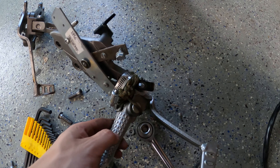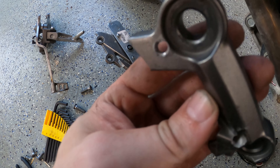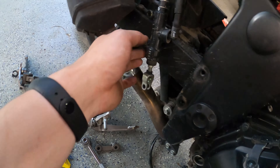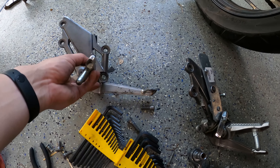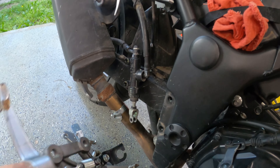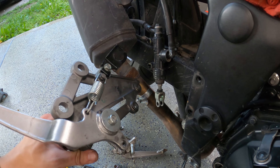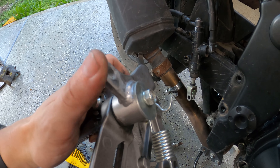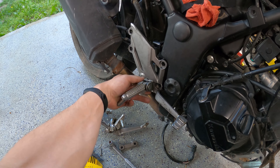Behold — all off of there, and in multiple pieces now. Here's the part that snapped off and the wonderful holes put in it with random fasteners. I went ahead and left the master cylinder here. The master cylinder that came with the new brake assembly — I'd have to bleed it if I put that on, and I don't want to deal with that, so I'm just going to stick everything back on here. There's a sensor for turning on the brake light, then we just put the master cylinder back on. No adjustment needed — just a cotter pin and a cross pin that go in to hold it on.